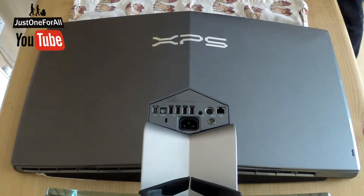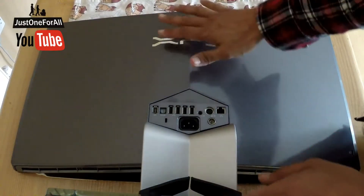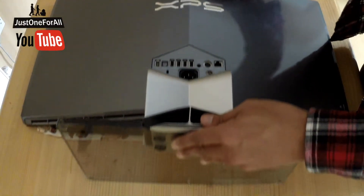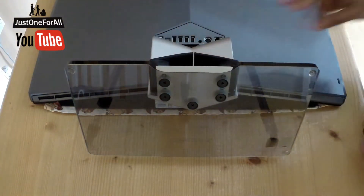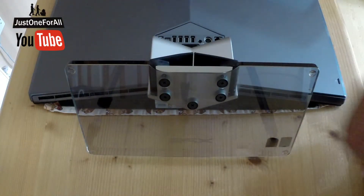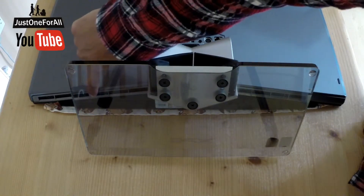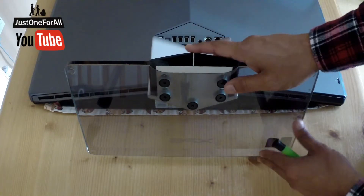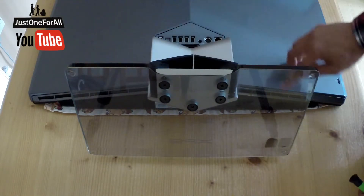Because I don't want to damage the screen or anything, I've got it on a tea towel here. That's the back of the PC. Now to open it — I remember the first time I worked on this, I was looking everywhere to open it and I couldn't find it. At the bottom underneath, if you look, there's one screw here and one screw there. If you guys have seen my other all-in-one Lenovo opening, it's very similar. So I'm going to go and undo those two screws.